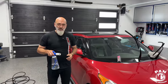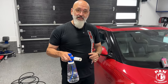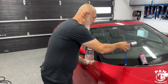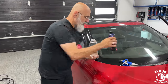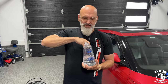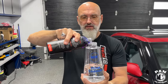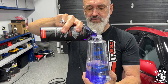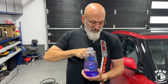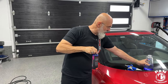Fantastic. All right, Ivan, so now let's move on to the traditional wash method. We're going to use a bit of shampoo and snow foam with the foam cannon. What product are we using? So we'll be using Incredible Suds. I have half the foam cannon since we're only doing half the car. So 500 milliliters of water, or around 16 ounces. And we'll just add roughly half an ounce. That's all you need, because that one foams a lot. It foams a lot, and the soap itself foams a lot as well.